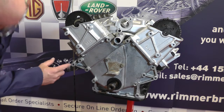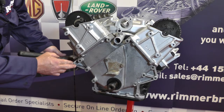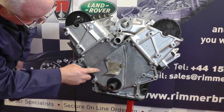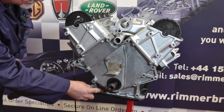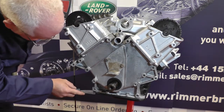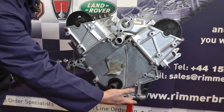There are five bolts that hold the sump underneath — it's important we take all those out and keep all the bolts together in the right order. We've removed all the bolts and now we need to gently tap on the side of this cover — not to get it off, but just to break the seal. Before we do any more we need to get a knife in between the cover and the sump gasket so that we don't break the gasket between the sump and the front cover.